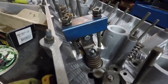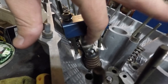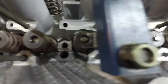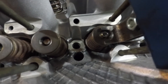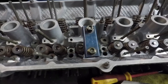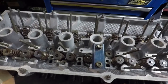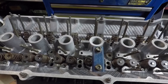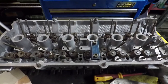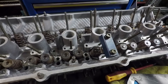To take the valves out and put them back in, I've made a very simple tool — it's pretty much just a piece of steel. It goes on this little push rod, and there's clearances there to allow the valves to come through. Then using the screws that actually hold down the cam caps is what we use to screw it down to tension the spring. Put the collets in, then just undo the screws and put it back in. I'll hopefully get some time lapse of that because it is a very boring and repetitive process.